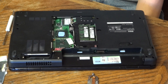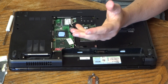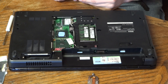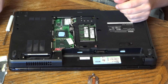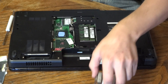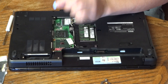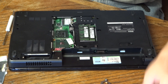The other thing I didn't mention that you'll probably need is something to clean off the old thermal paste off of the processor. I already went ahead and did that, so mine's nice and clean. If you're replacing the processor, you don't really need to clean off the old one, but you would want to clean off the bottom side of this heat sink where it seats onto the processor, and I've already done that. They put a little thermal sticker onto the GPU — I'm going to take that off and just replace it with some regular thermal paste while I'm doing this anyway.